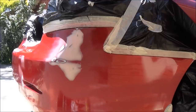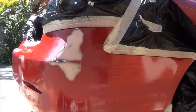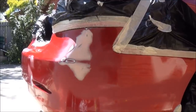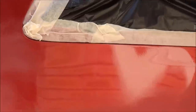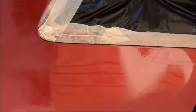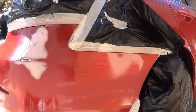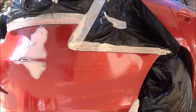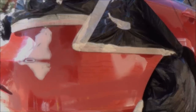Before that, it's a good idea to go with some wax and grease remover, because even though the bumper has areas you didn't really sand down, those places might still have some wax. Get them cleaned up.